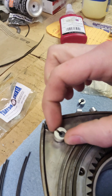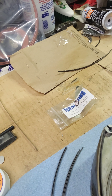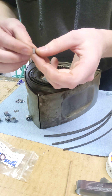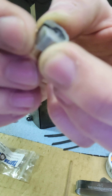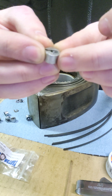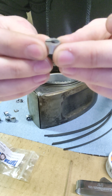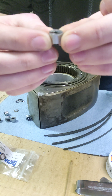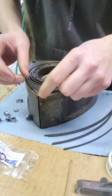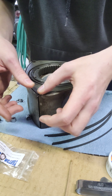You cut it down and it leaves a nice angle so the side seal butts up really nicely against it. There's a little beveled edge around the top part — you can see it's got a little bevel to it. On the opposite side it's sharp, machined flat on that face, so it leaves a sharp edge all around. The key is that sharp edge has to be pointing out. I had to search for days to find that information when I was first setting this up.